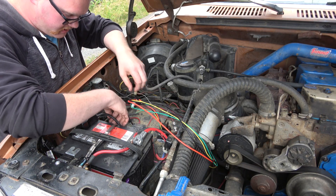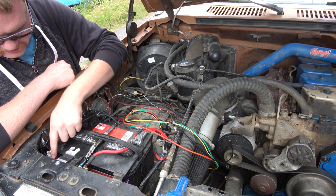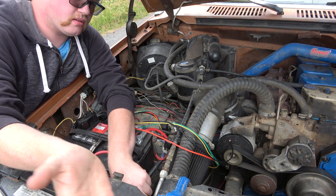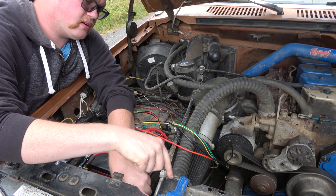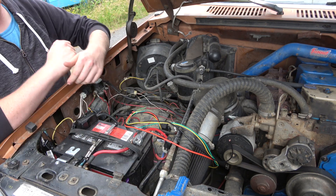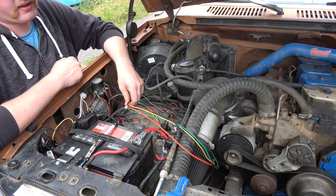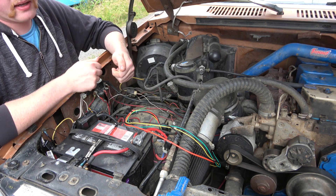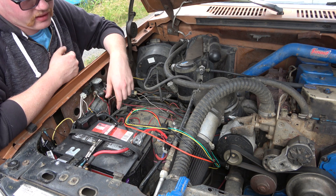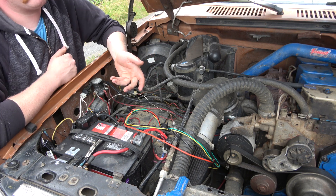This is the wire for the temperature probe. I've got this running - I was trying to hide it as much as possible, so it's kind of buried down here. This runs around the battery, over here, through the crossmember, and then I'm sticking it through the front of the radiator because I had access back there with the grill off. It's right up against the tank on the hottest part of the radiator, where the water inlet is going in. It's got full contact right up against metal. If it becomes an issue, this thing's adjustable so I can adjust it to turn on at a cooler temperature. I don't know what it's set to right now, so we'll just have to play around with it once it's at operating temperature.